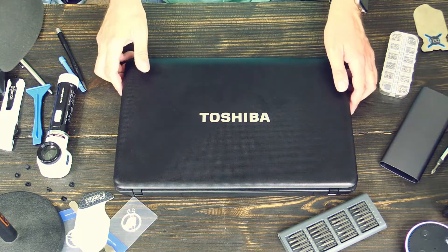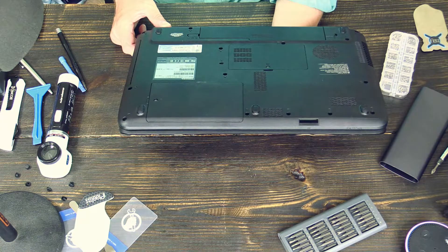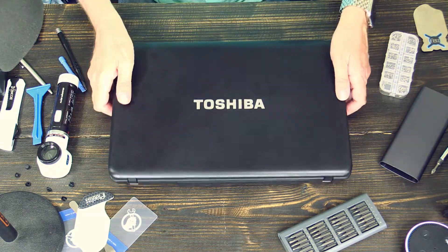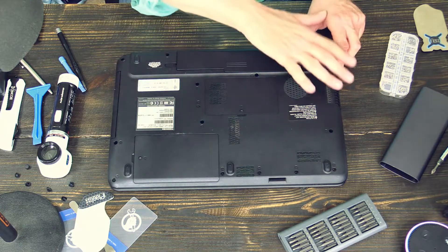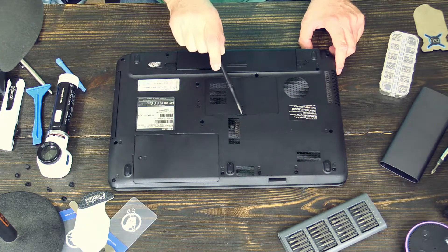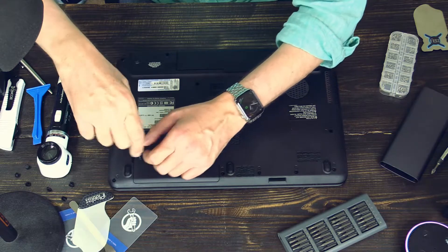Now I'm showing you how to replace the hard drive in a Toshiba Satellite C655D-S5518. To do that, turn the laptop around like this, and you have two doors here. Very important that it has doors, which means you don't have to take apart the whole laptop just to get to the hard drive, like some Dell computers. Behind this door there is a little logo — this means RAM. And behind this door is the hard drive. So let's not bother with the RAM door; let's open up the hard drive door.